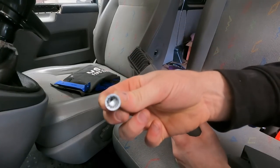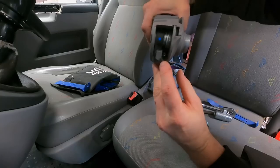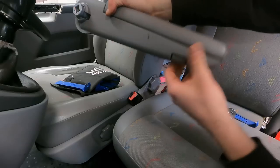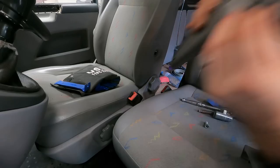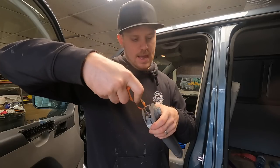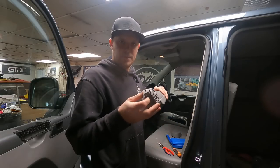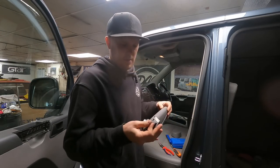There's the bit that snapped off! Bolt is out. This is the part that needs changing. Get in there - there's a little screw down there which is a rod that runs all the way through to the adjustment for it. You need a T15 Torx screwdriver or bit to get this pin out. Just keep undoing that screw until it comes loose, then pull that piece out, and then that piece will come out as well.